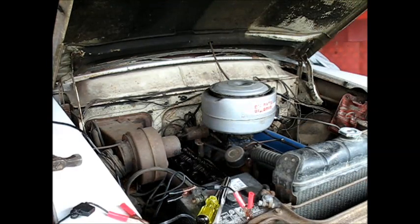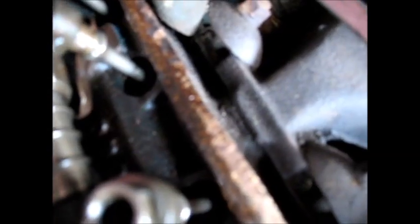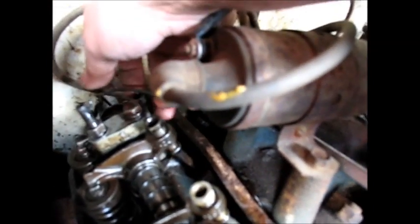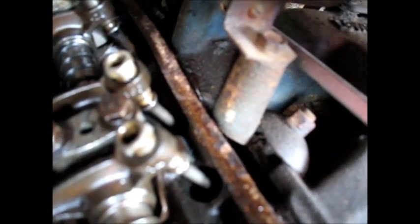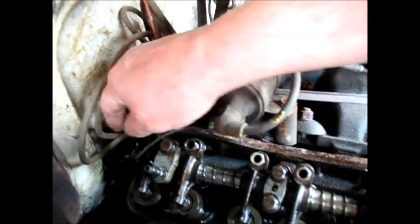Okay, I'm glad I did that - the problem became evident right away. I don't know if you can see it or not, but this rocker arm is sticking way up here in the air - that's just not natural. That, my friends, is at least a broken rod if not bent, if not fallen down into the motor somewhere. The rod that's supposed to be right here working these rocker arms is just gone.